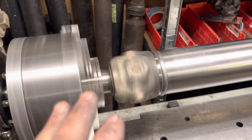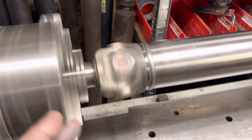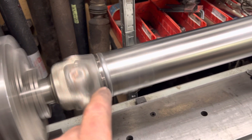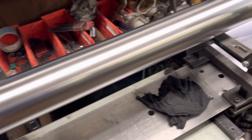We did that on this one — do it on a lot of them, machine them to fit myself here in the shop. So that took care of that. It's a 1330 weld yoke, a pair of 1330 Spicer snap tights, Spicer weld yoke in this case, and Spicer tubing.